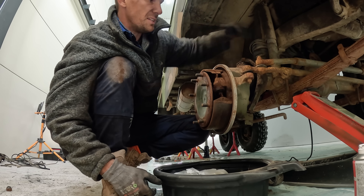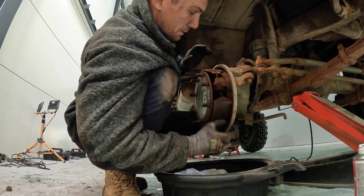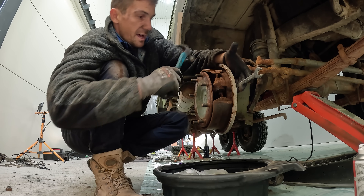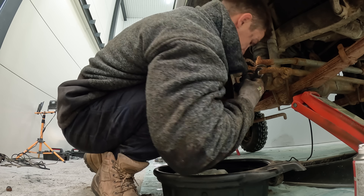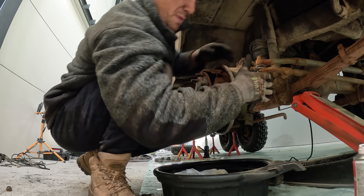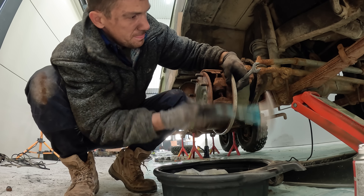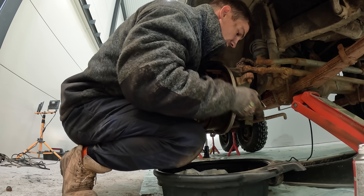I've undone both brake lines. The front is peculiar in that it has two brake cylinders for the pads — a slightly different drum brake setup. There's a bunch of 18-millimeter nuts on the back of this hub, so in order to pull the whole assembly off with the main portal gear I need to get those off. There's not enough room for the impact gun, so I'm going for the tried and true method of spanner and brute force.